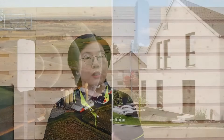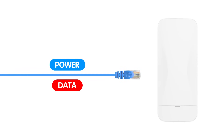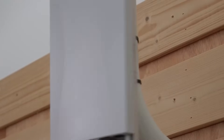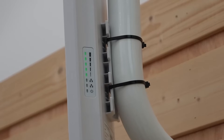With your plan in place, it's time for installation. Start by mounting your wireless bridges — position them high on a rooftop or poles for the best signal. These units are PoE powered, so you can minimize cable clutter. Configuration is a breeze: simply power on the units, connect them to your network, and pair them in a clear line of sight. Our Fast Cabling wireless bridges come pre-configured, so all it takes is one tap of a button to pair them up. Check the LED indicators to confirm signal strength, and adjust placement for better alignment if needed.